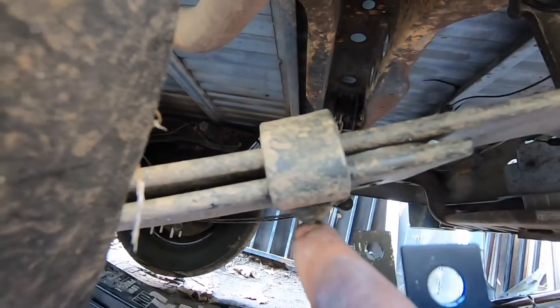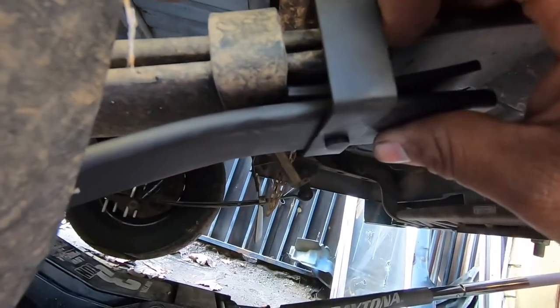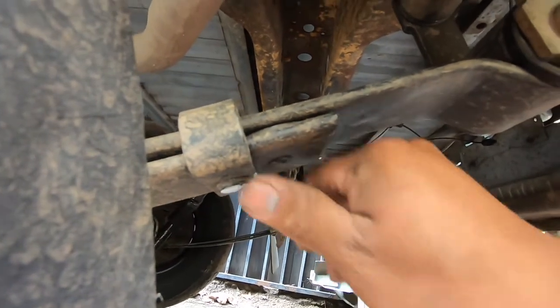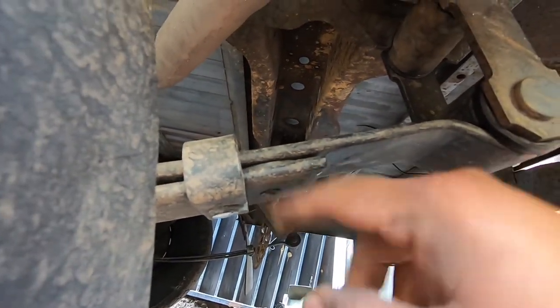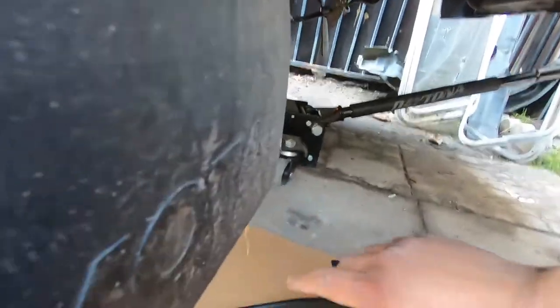What we're going to do is just hit it with the grinder — not all the way down, but at least so that pad can make some contact with the leaf spring. So let me pull out the grinder and do that real quick. This is how much we took off — it's not pointing anymore, and the pad doesn't contact that piece but it's closer than before. We're going to give it a coat of paint and then throw it back on.